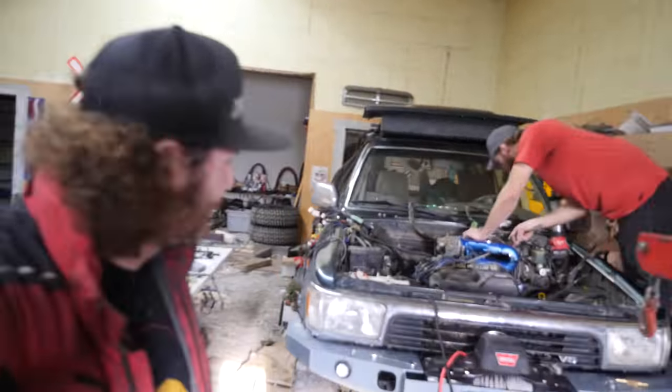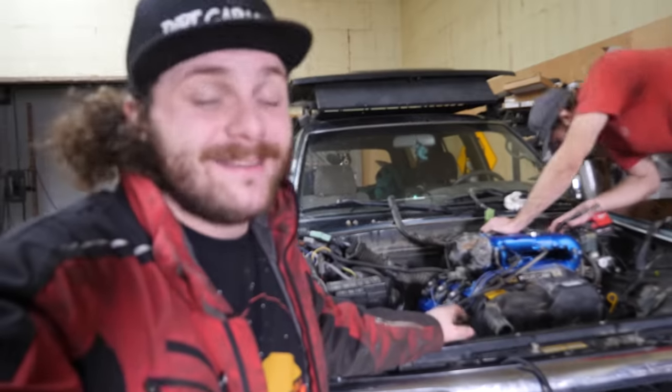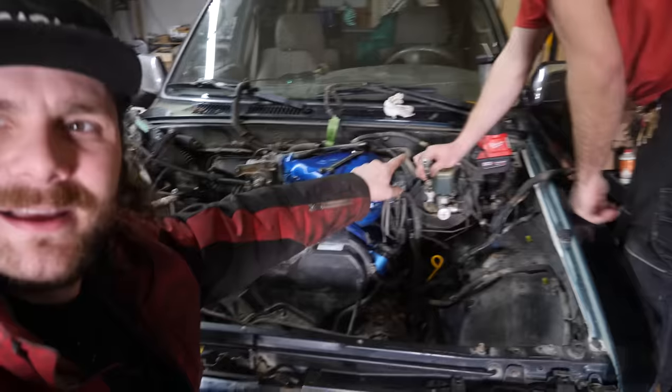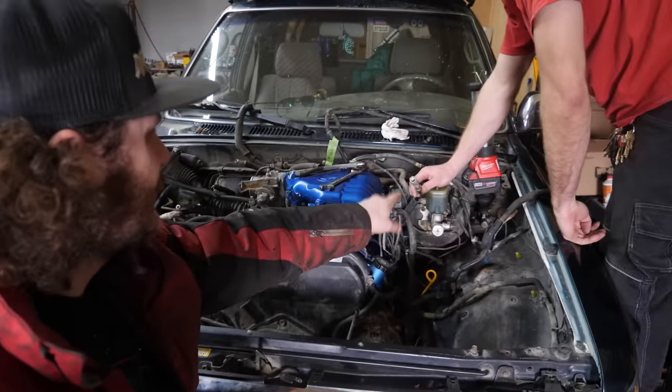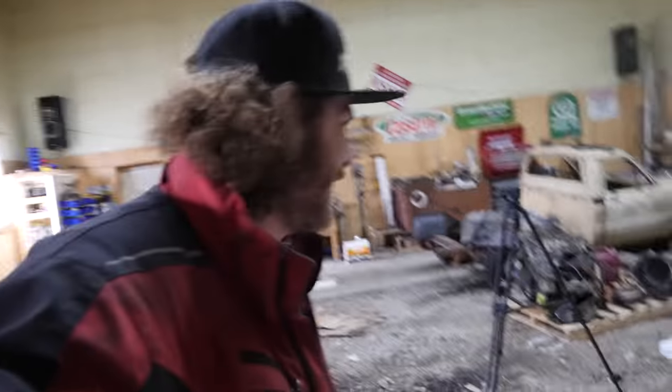All right, so now we're looking at day 3 here, working on the 3-4 swap. Yesterday didn't go entirely as planned, mostly just based around moving the dipstick. But today, well, today I'm feeling good. So first off, we are starting with connecting fuel lines here. What Trevor's holding right there is the high pressure fuel line going into the fuel rail. And we are going to connect that, well, to be honest, a pretty jank way to get it running for now.